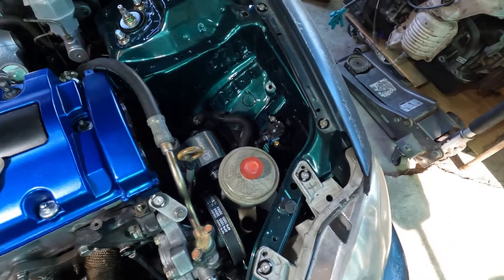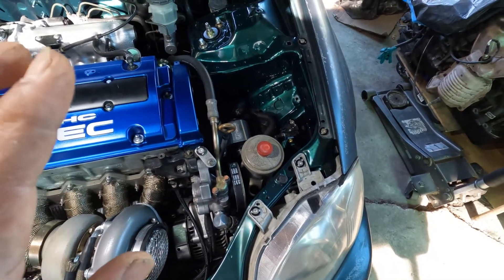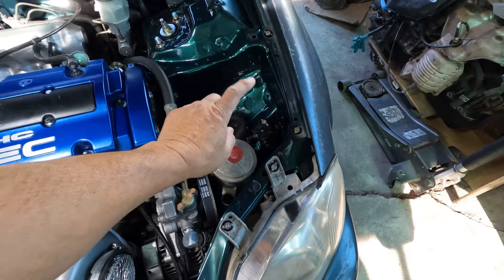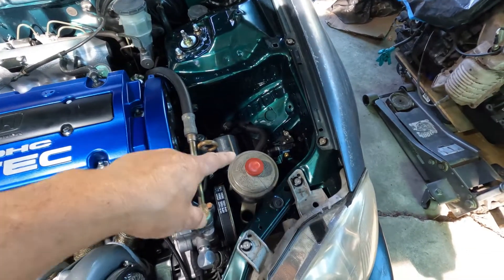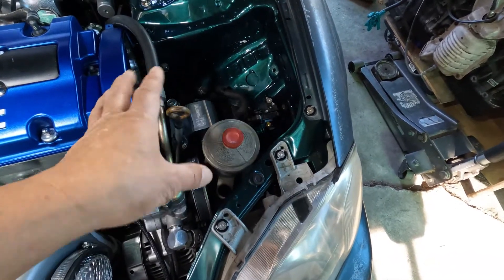It's not a good idea, now that I think about it — having more power drawing off from that source. So what I did is I cut it and installed the lead wire to the fuse box now. It's a full-time 12-volt power supply. So hopefully that will help get rid of that tapping sound.